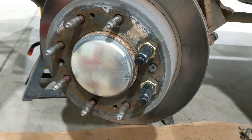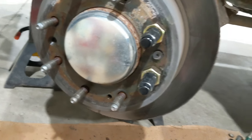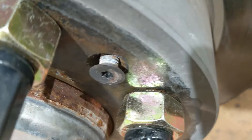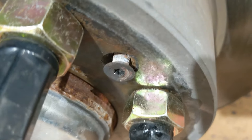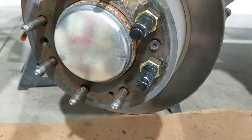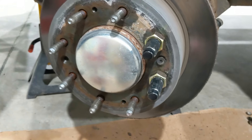My issue here is these 2500 HDs and 3500s and some other vehicles do this where the rotor isn't just pinched between the hub and the wheel — they also add a screw here. It's a metric screw with a T30 Torx and a countersunk chamfered head. I was having a lot of trouble; I couldn't get this retaining screw out, and with that in there you can't just pull the rotor off.